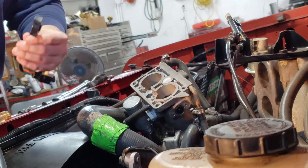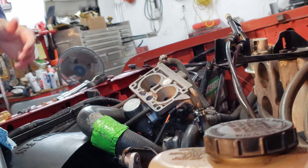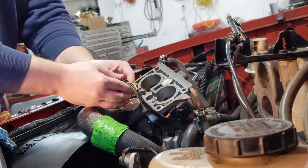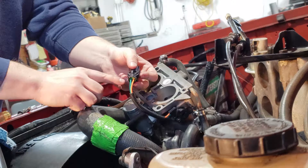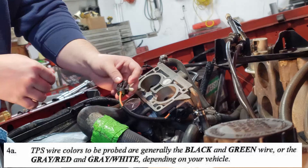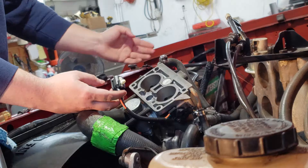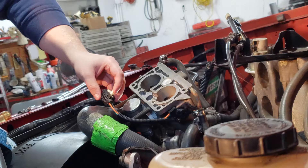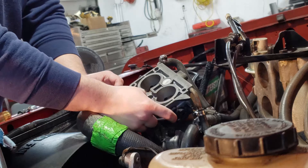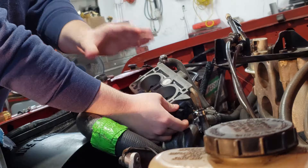Take your brand new sensor and two bolts and install it on there, but don't actually tighten the bolts down. Now plug the TPS in and turn the key so you can read the voltage from the TPS. You should have three wires: an orange one, a green one, and a black one. Some years may differ, so check the Ford Performance paper. For my case, I need to probe the green wire and the black wire — black should be ground so I can check it at the battery — and make sure the voltage is at .96 to .98. If I cannot get that, I'll have to take the TPS off and drill the mounting holes out a little bit so I can maneuver the sensor to get it in range.